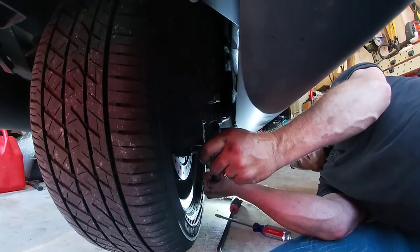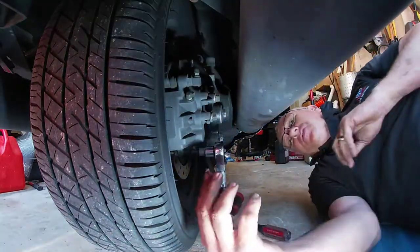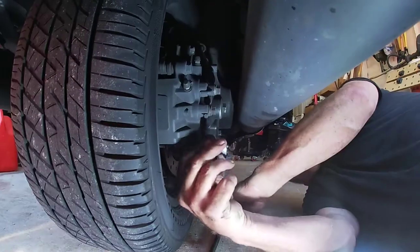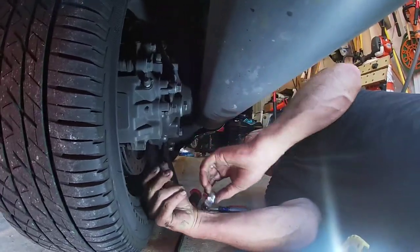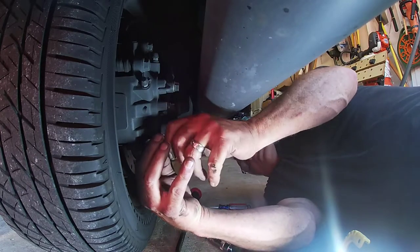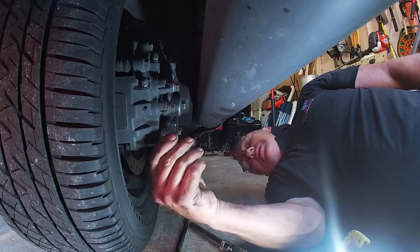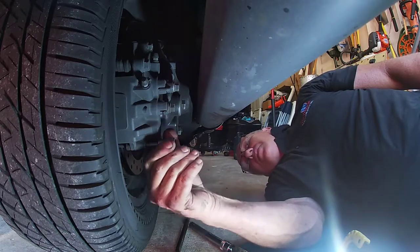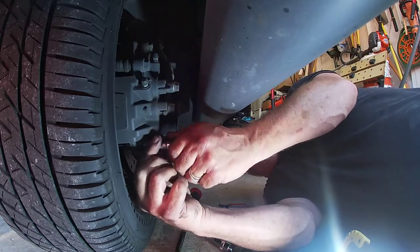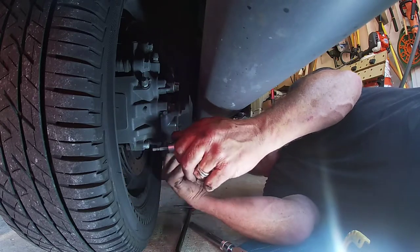These are a little different. We've got to — let me see that light. That pin runs in there with whatever hex size that is. It's a little different because you can't get in there like you want to. I've already used a bar to slide up under the pad and push it back to close down the calipers, which were two-thirds at least of the way out. That's how I knew those pads were really worn.